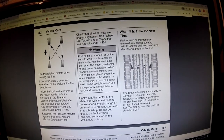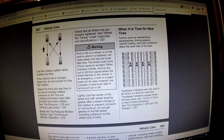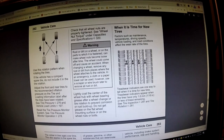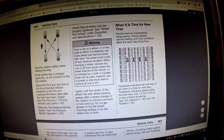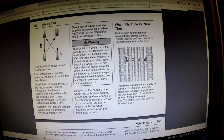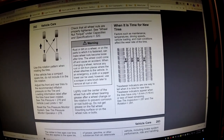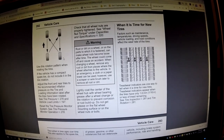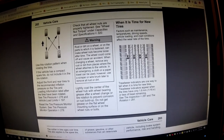Here is the rotation pattern. You need to do this type of pattern for optimum wear. The only time you don't do this is if you have different tires in the rear than the front — then you'd rotate rear left to right and front left to right. If the tire is directional, it will be indicated by a special arrow on the sidewall. No arrow means non-directional. My Bolt came with non-directional tires, so I can rotate them across the vehicle in the standard pattern.